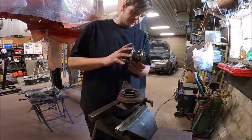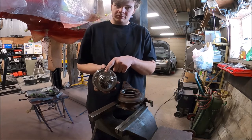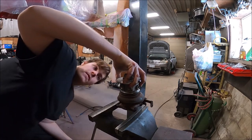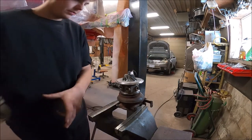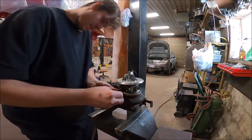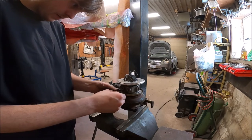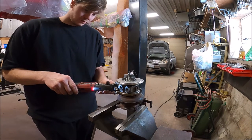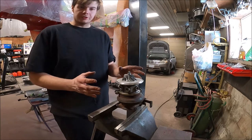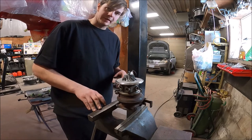After you've got it looking nice and clean, it's time to begin reassembly. Make sure you align the little dowel with the hole in the cartridge — just like that. Next up is the clamp. I only snug it up for now since when I put all the other tubes on it might get in the way. I try to orient it in the same position, though sometimes you may have to adjust it a little to one side or the other.